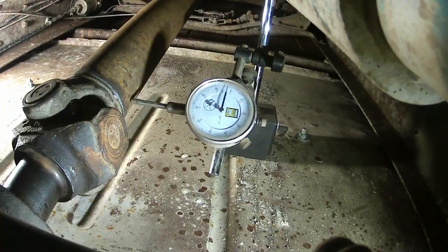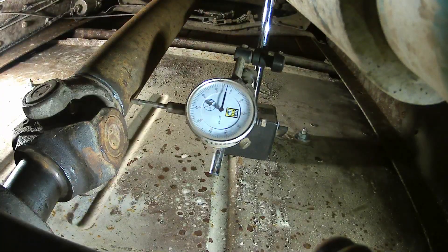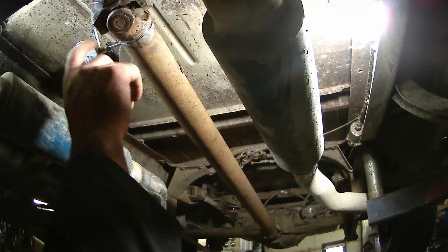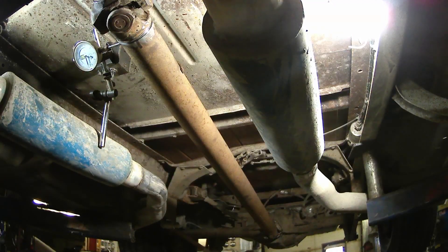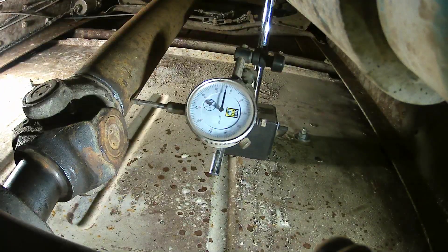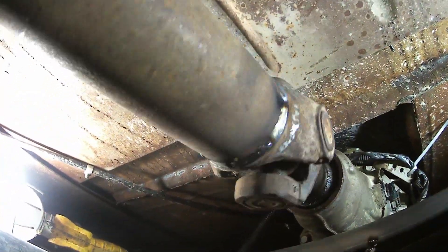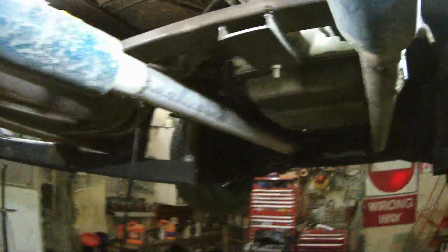Honestly it's probably straighter than the stock drive shaft. If I'm within 10 thou I'm pretty happy with it. You've got play in the yoke so it's always going to have something, whereas when I do it on the lathe it doesn't have that play. Now I'll take the welder and I'll do four tacks so it doesn't get opposite heat — I go four corners opposite of each other, then I take it off and weld it fully on the bench. That's pretty much it, that guy's good to go. I'm gonna zap those right away, pull it off, weld it on the bench — call her a date. There you go, all welded in, good to go. Thanks for watching.